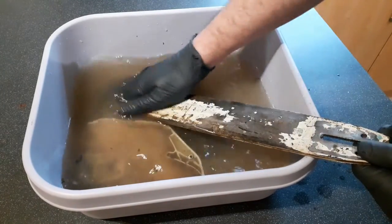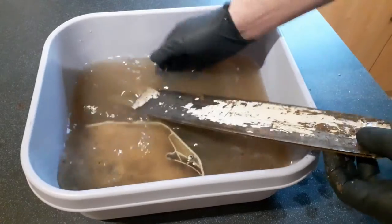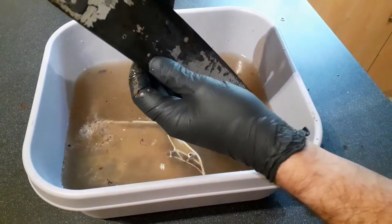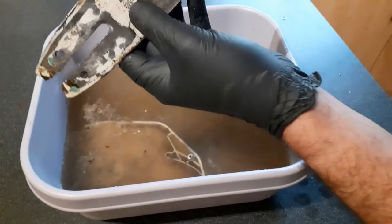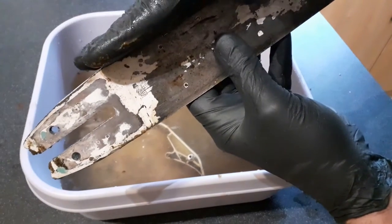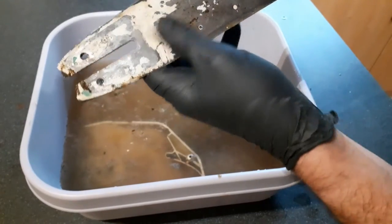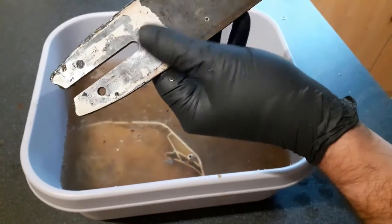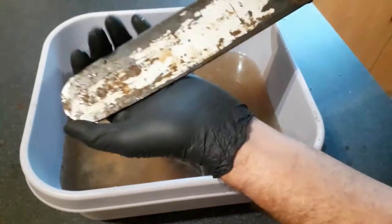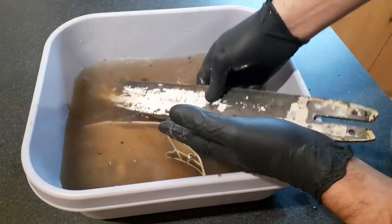I'm going to clean one side of the bar first, then I'm going to clean the other. This now has me thinking, should I be replacing this bar? On every chainsaw bar you will find, though it's obliterated on this one, an instruction for how far down the rails can wear, how much gap you can have before you need to replace the bar. This bar is still quite new, believe it or not. It is still within its tolerances, so if I can clean it up and if I can free that nose sprocket wheel, then I want to see if I can save it. Okay,